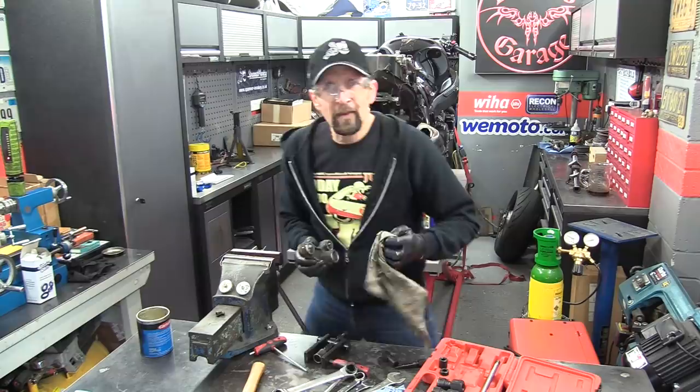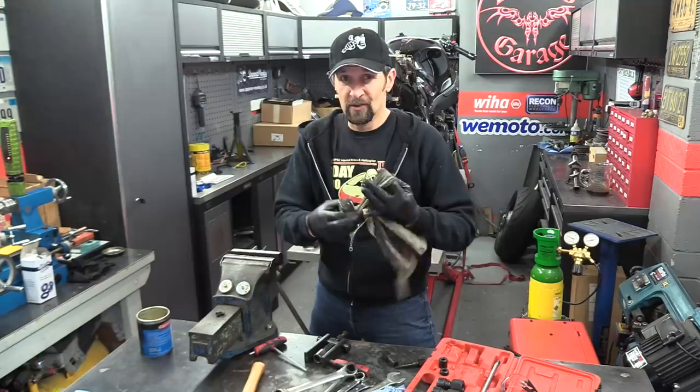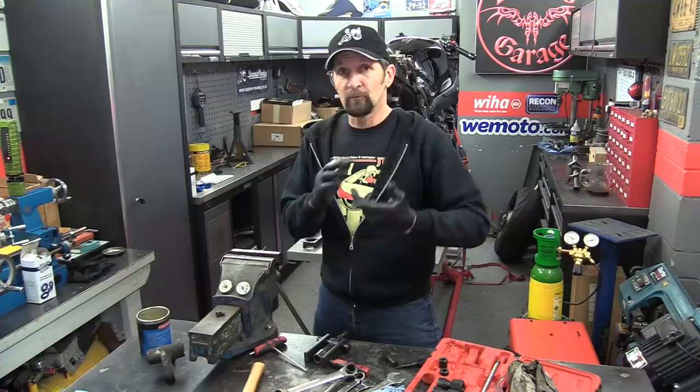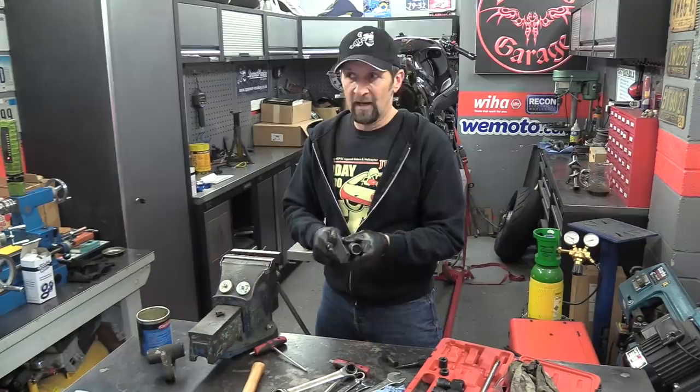All these bearings, every single one of them smells of sulfur, like rotten eggs, that kind of diff oil smell, gearbox oil stuff when it's really old. So it's a sure sign that they've probably never been replaced. And if the bearings aren't rusty and you still get that smell, you can actually clean them out completely and re-grease them if you want to. If you can't afford the bearings to replace them, the next best thing is to strip, clean and re-grease them every 5 years or so.